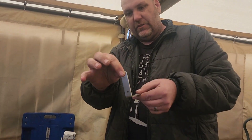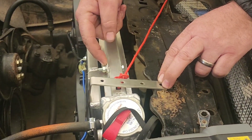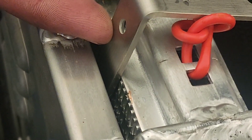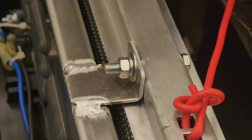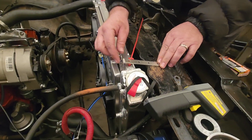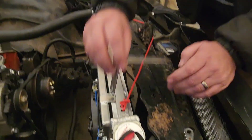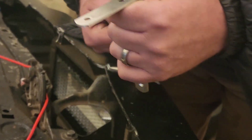We're going to take a stainless steel L-bracket. It's going to mount like that on this area here. In order to get it proper, we've got to cut out right below this eyelet and then mount it onto this. We need to check the sizing — it's actually just almost the right size, so we won't have to cut much off. We'll use these existing holes here and that'll hold the top pretty well. Then I can get rid of my wonderful little red cable. So slice here, round it off, give it a pretty look, and we'll be good to go.